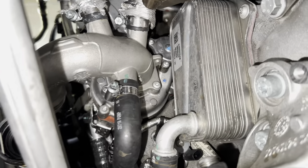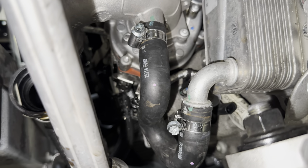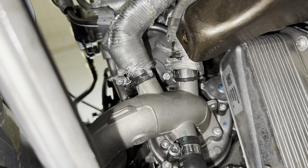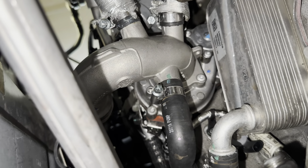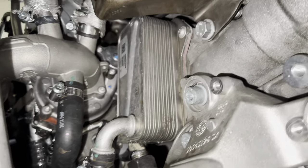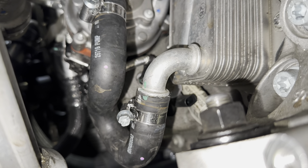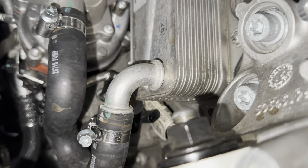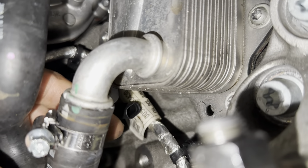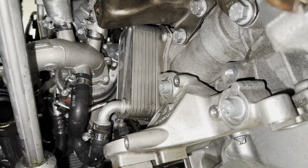As for the bolts, I believe these are T20s. There's no torque spec for them, so just good and tight — don't go cranking super tight so you break them, but trust your judgment. We have the extension to the water pump on. All these hose clamps, I make sure I face them all toward the easiest path to access them, so if I ever have to take this off again I can see them right there. Got our cat bracket back in and tightened down our three 16mm bolts. Now we'll plug in the connector and run the wiring back through the hole with the push pin.